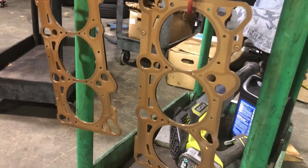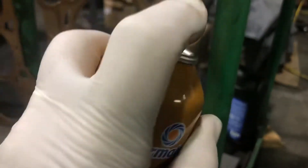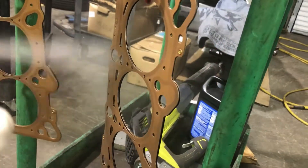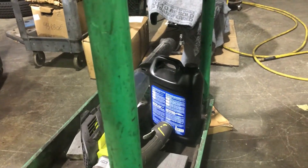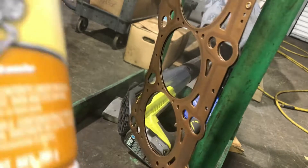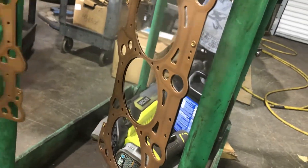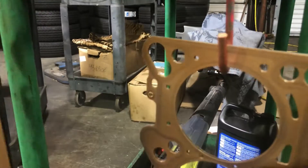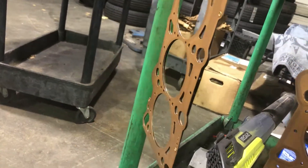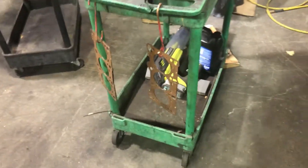After I let them tack up a little bit and flash over, I come back with a nice second coat. One last coat because I'm running out and don't really need it for anything else on this car — not enough to do a second job. Give it a good dusting on both sides. Now your head gaskets are ready to be set on the block and immediately bolt the heads on.